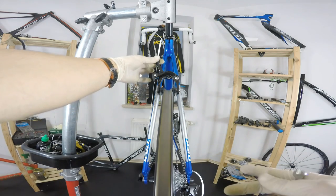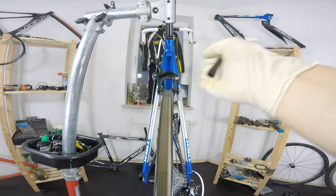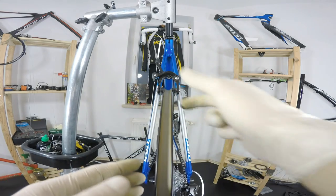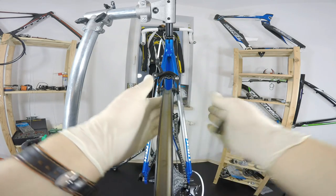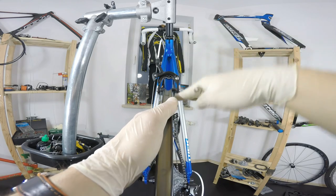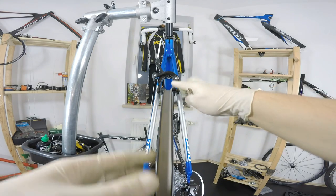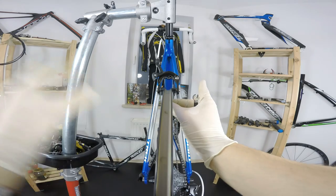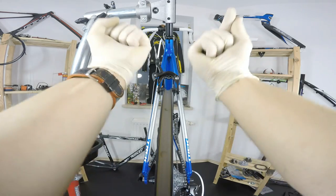What I'm gonna do now is put more and more tension on my caliper, finding all those spots where the rim is touching my pads. Once more, in many tutorials you would hear that first you true the wheel laterally, and then you see whether it works up and down. In my opinion, we should do it simultaneously. And if I see any up and down movement, what do you do? If you see your rim going up, you would put some tension on both right and left spokes, so that those spokes with more tension would pull the rim down.